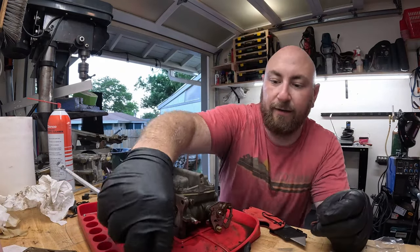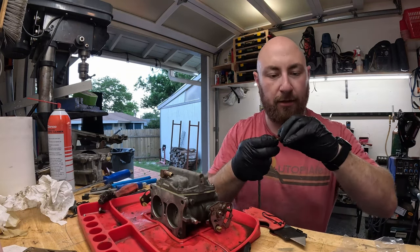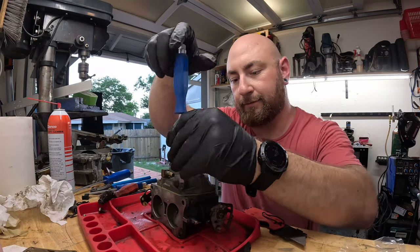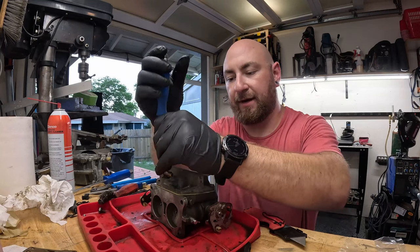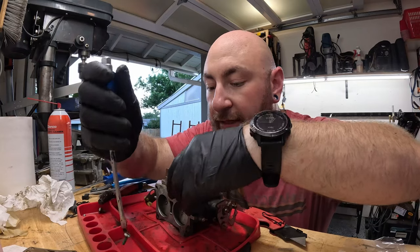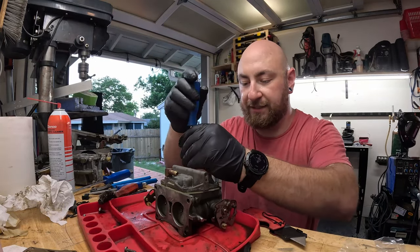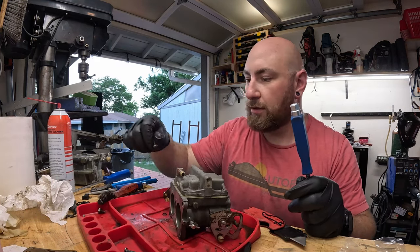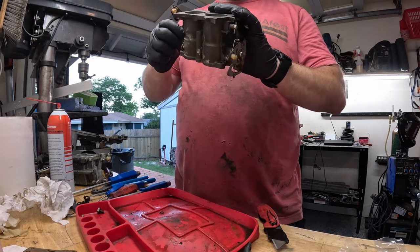And you know what we forgot? There is supposed to be a seal on the bottom of this thing that I completely forgot about. And this is a perfectly good example, right? No matter how much experience you have, no matter how many carburetors you've rebuilt, it's always important to look back and check what's left in your parts pile. And I saw that there was an extra seal there. Didn't make any sense. So, and then this guy can just pop right in there.